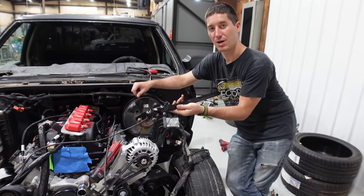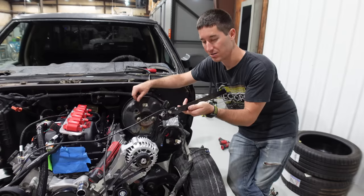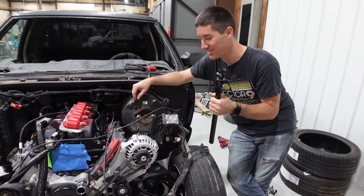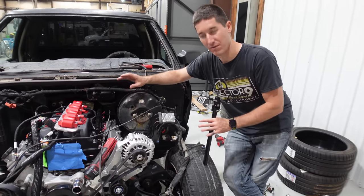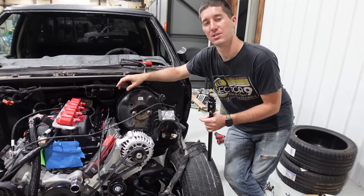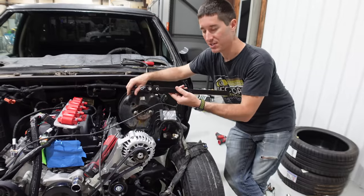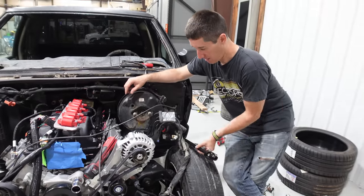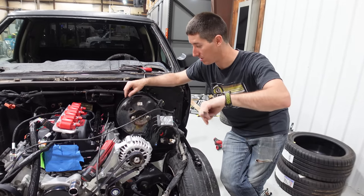Also, don't forget when you're buying your Holley swap kit, you need to buy the steering shaft because it lets you clear your aftermarket headers. You also want the Hooker headers. Those are the things you basically have to have to make this stuff fit unless you want to extensively modify your frame. I want it to be nice and drive nice, so we're going all the way with this thing. Steering shaft is key — Holley sells that, it's all part of the swap kit. I'll try to put links for those in the description below.